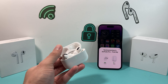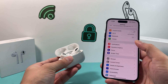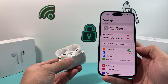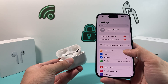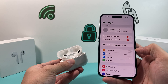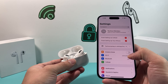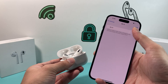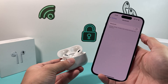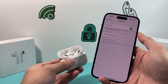The next thing to do if you're still having issues is check your phone. Go into Settings and turn on Airplane Mode for a second or two, then turn it back off. That will reset the network and give it a refresh without deleting anything. Along with that, turn off Wi-Fi for a moment and turn it back on. Then turn off Bluetooth, give it a moment, and turn it back on. For AirPods to connect, you always need Bluetooth on — that's how the AirPods get detected on your phone.